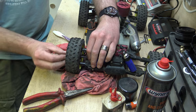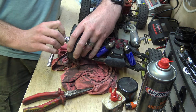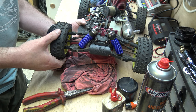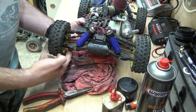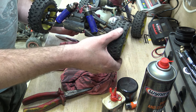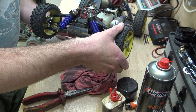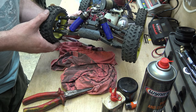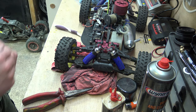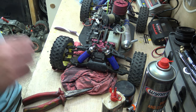Now, if I put this nut on and do this nut up, yeah, that wobbling is in these links. It's not in the bearings at all. Now this one, it's all in that bearing. But this one, you see it's in the steering link there. Needs a little bit of attention. But that is 100 times better. And that should roll a lot better than it ever has before.